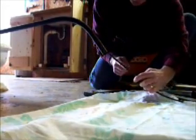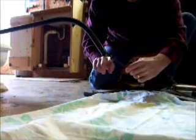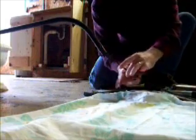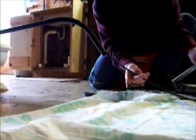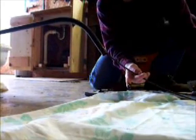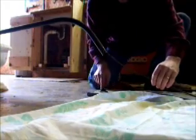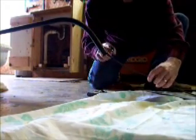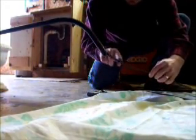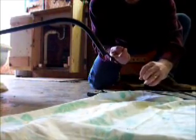And you can put it back up in there as you go if you want. I'm just using an old piece of jean material here. I'll squeeze out a few drops of this grease onto it. Now you don't have to go crazy with this. If you get too much on, there's a good chance it could wind up down in your trimmer head. That won't do nothing but make a mess.